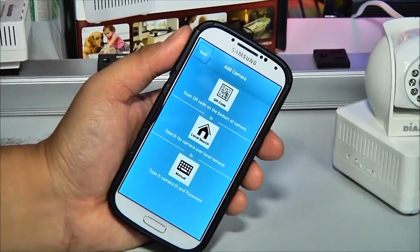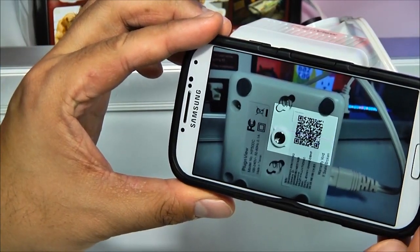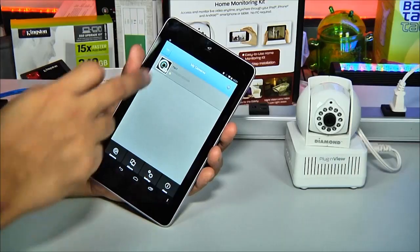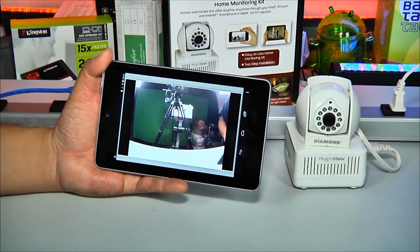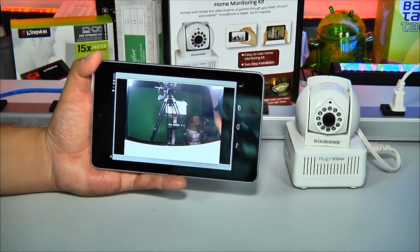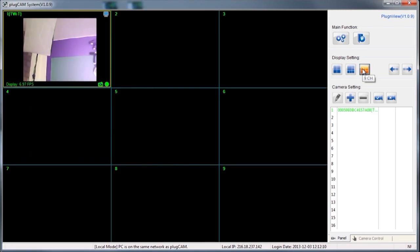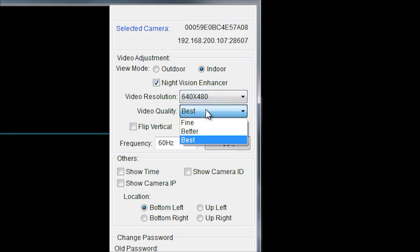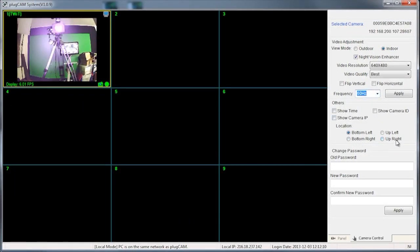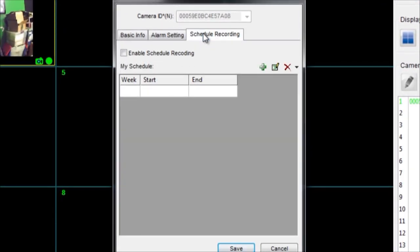The Plug-in View can be accessed from any Android, iOS, Mac, or PC device. The mobile interface is well designed — setup entails scanning the QR code on the bottom of the device to automatically transfer all camera details to the app. There's also manual entry, but given the tediously long strings of data, using the QR is recommended. With the Mac or PC client, the PlugCam software gives a grid view of all cameras and allows automatic snapshots and video recordings. You can change resolution, adjust for indoor or outdoor use, change passwords, and set motion triggers that automatically record video, sound alarms, and send email warnings when something enters your security zone.